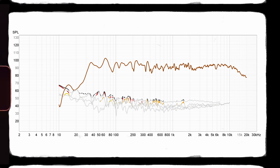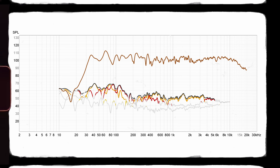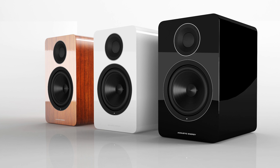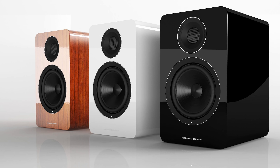Max SPL output is something around 105 dB — that's a lot. I did some measurements with REW from my listening position and was happy to see that at 90 dB the distortion graph looks really clean across the entire frequency range. Cranking up the volume a little more to 100 dB, we start to have a little bit of distortion in the midrange where voices and instruments start to be a little shouty. So 90 dB is already, in my opinion, a great listening volume, especially in small to medium rooms, and I was really satisfied with the amount of volume and dynamic.